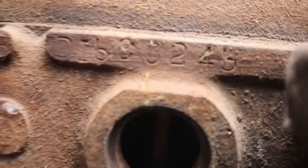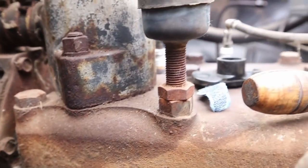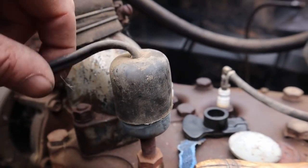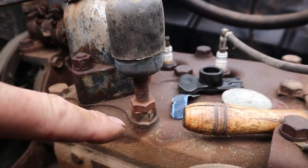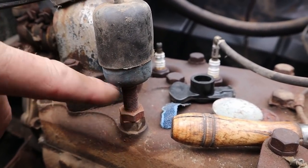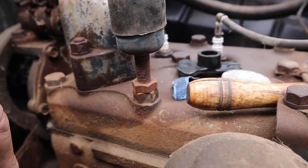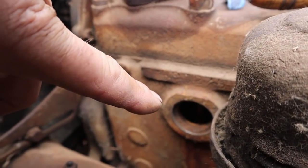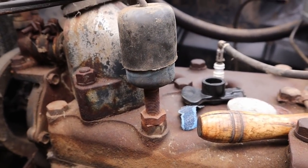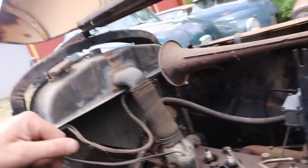Another interesting thing we can see, I don't know what these were in your part of the world, but can you see the tube inside there? That tube is this guy here, and that's an old-fashioned block heater. You take out one of your head bolts and put one of these hollow head bolts in, and then you slide down this resistance heater. That's what they used to run before they had the type where you would punch out a core plug and put it in there. They call them, I think, pencil style. It probably still works. Probably not going to try it.